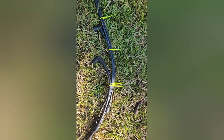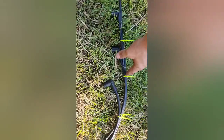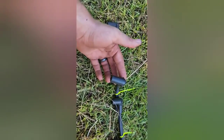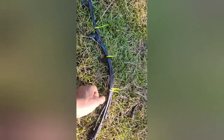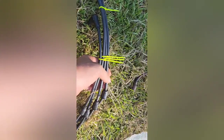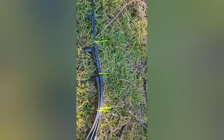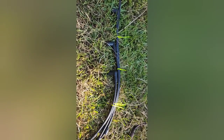I put all the wires in, routed them down, marked them about where they need to go. I then came with these little yellow zip ties and started bundling them up together like a little wiring harness, giving myself enough room at each plug that I can manipulate the wire to be able to get onto the spark plug itself. I know this one is the number four cylinder, three, two, one — going down to their individual spots. I might actually put a couple more zip ties. Eventually I'd like to get something a little prettier than zip ties, whether it's the wire loom thing, the plastic slide-over things, or whatever.